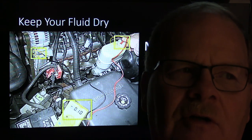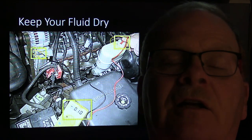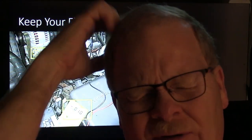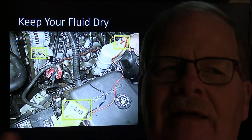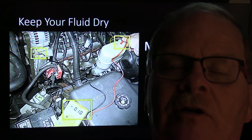You're going to have a scan tool connected to run the pump on some of them, this kind of thing. And you need to make sure you bleed them according to that. Now, I talked on a previous one about how, on this '08 Nissan pickup truck, the body shop didn't bleed them in the right order, and they wound up with a brake pedal that never felt right until we actually went in there and bled them in the right order and straightened that out.